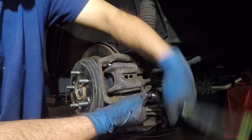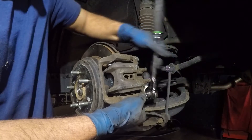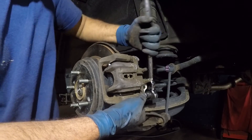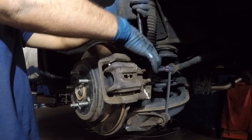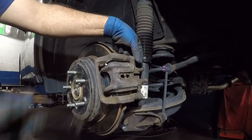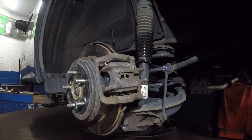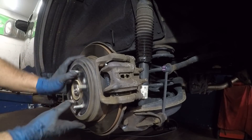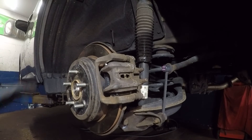We're gonna tighten both of these bolts and that will be it. Make sure you torque this bolt — snug it first and then get your torque wrench. Get the second one also, snug it, and then torque it. The job is done. Please subscribe to my channel. Drive the car — right now I hear no scrapes or anything like that, so this is good. Job well done.